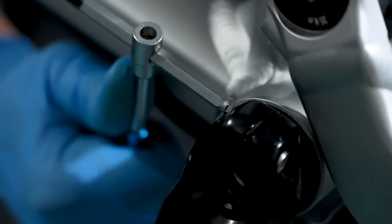I don't know without looking at it, but first check that your cranks are tight — make sure they're done up. That clicking noise could be that they've loosened. Get hold of the cranks and give them a real twist to see if they rattle. If everything is good, the usual culprit of a clicking noise is a bottom bracket wearing out. Especially if it's press-fit, it will get dry and start to creak within the frame and click, and it just needs replacing. Sometimes a badly installed one will click and creak and reinstalling it won't help — you need to replace it.